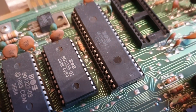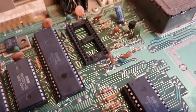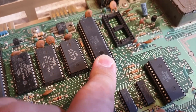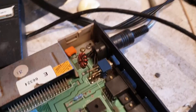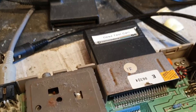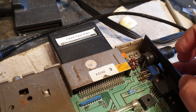So you do need a working CPU and a working PLA. What I wanted to show you was how, in this particular instance, I've taken this out, but we've got a dead CPU which is causing the problem. So what I'm going to do — it's all powered up — I'm just going to put the dead test cart in. With the dead test cart, you need to wait around about 10 seconds after you turn it on for it to come up or to start flashing straight away.